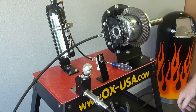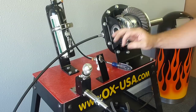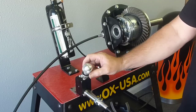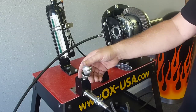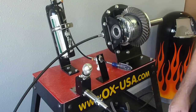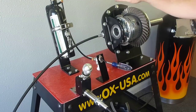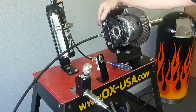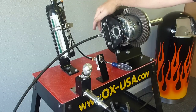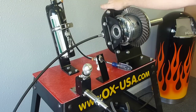It's really fairly simple. We do get a lot of tech calls on it, but that should be the main thing. It's easiest to see that you have the right amount of slop if you take the knob and shifter off. You can feel it a little bit by pulling it up, but it's easier with it off. So that should do it — tighten everything down and you're good. We saw how the cable was adjusted in a different video, so take a look at that if you're not sure. Proper thread depth into the piston on the shift fork will make sure everything goes smooth at this end.